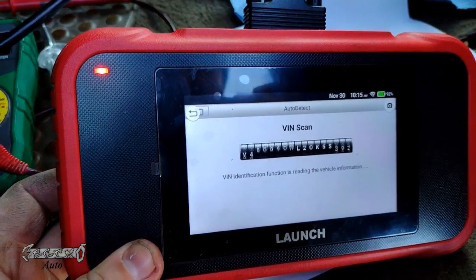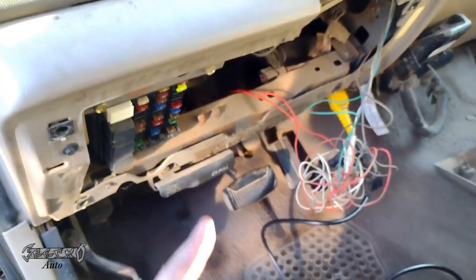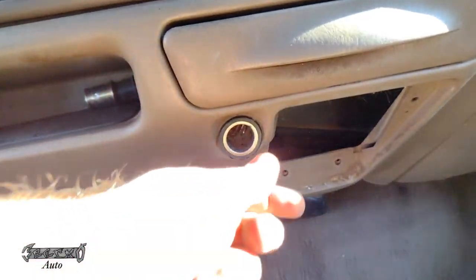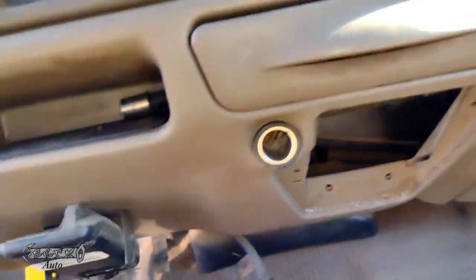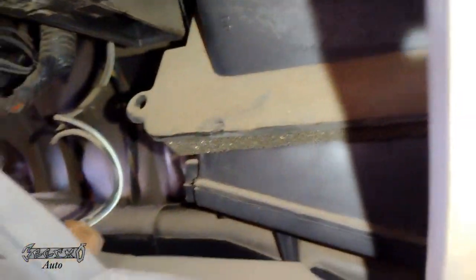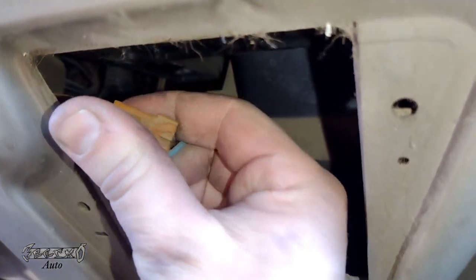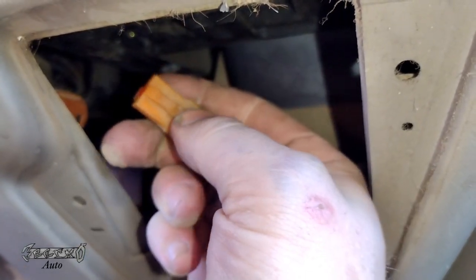This fuse kept popping over and over and I couldn't figure out why — this truck had a bunch of aftermarket nonsense all in the wires. The cigarette lighter is part of that circuit as well. So what I did is I took this panel off, took my cigarette lighter out, reached back in there and disconnected it. I don't know if the cigarette lighter was causing it to constantly blow, but I know phone chargers can blow it a lot of times. I disconnected it — you just push the button and pull it out, though it was super stubborn and I had to use a little flathead to help. After I disconnected that and put in a new fuse, it started working fine.